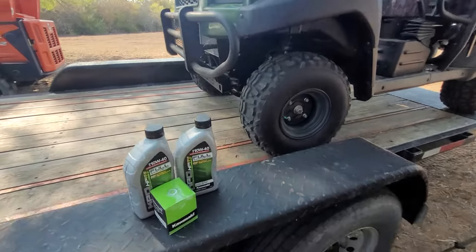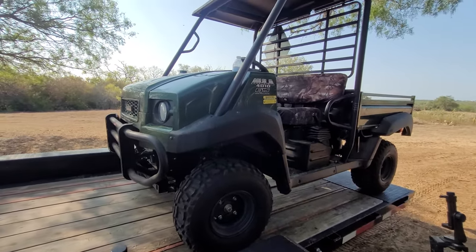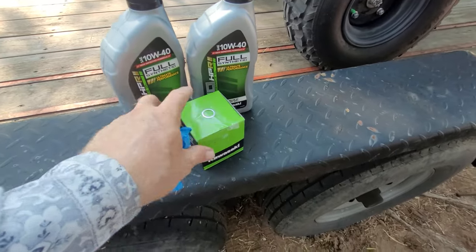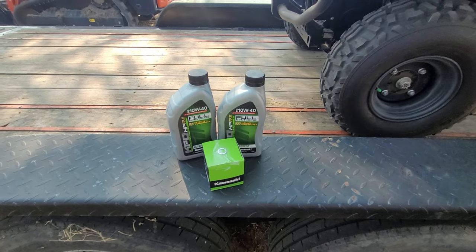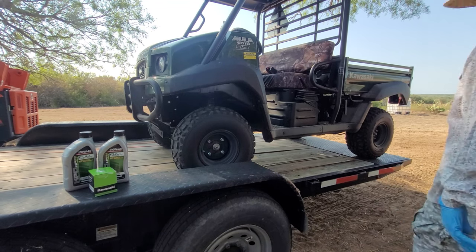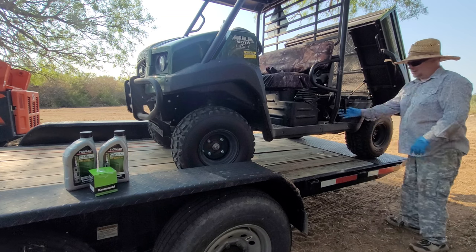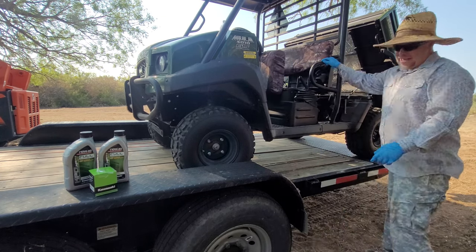Alright folks, here's the first oil change on this 2023 Mule 4010 four-wheel drive power steering. Requires 2 quarts of oil, filter, crush washer, 50 hour break-in service. First thing we're gonna do is lift the bed up here. Got these locks, you lock it down. Tilt your seat back,